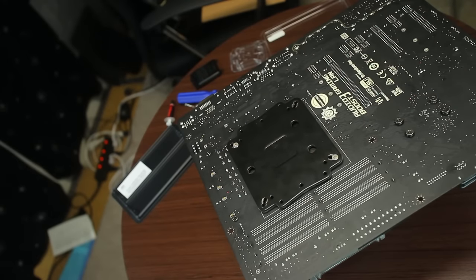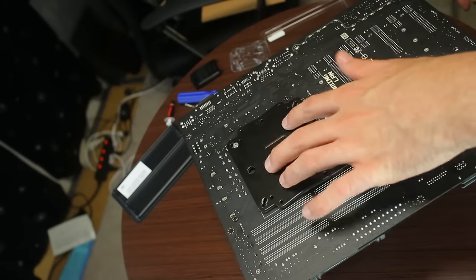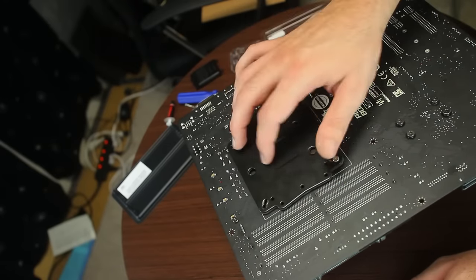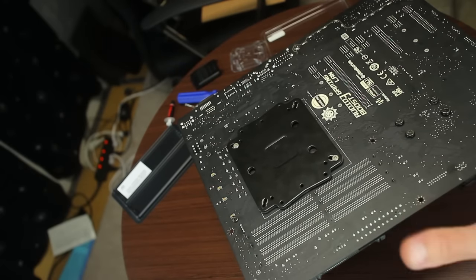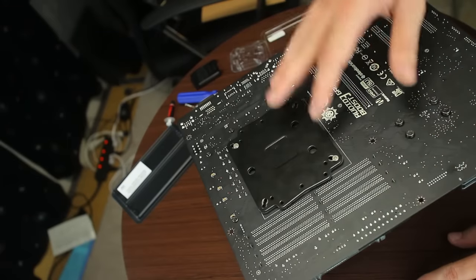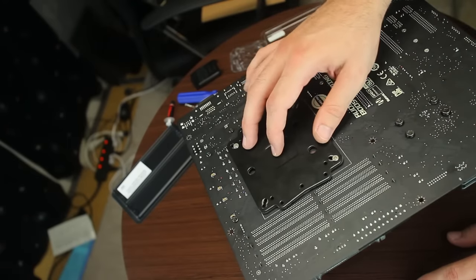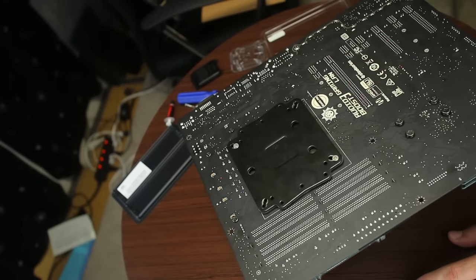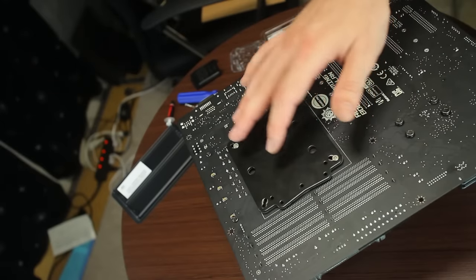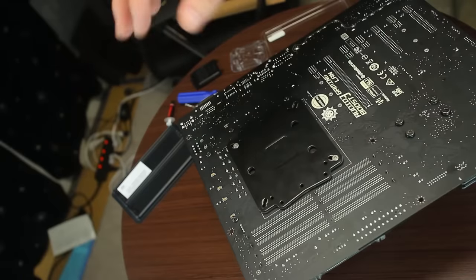All right, so this is an LGA 775 CPU cooler. Now, this bracket does not fit the LGA 1151 or the MSI board. However, as you can see here, it fits diagonally, which will be fine for sitting the board horizontally, with the cooler just sitting on top of it. I probably will be buying a new CPU cooler that fits this properly, as for the long term this is really something I wouldn't recommend. But that being said, I'll be able to do my review sooner than I expected, as I won't have to order a cooler just yet. So as ghetto as it is, this will work.